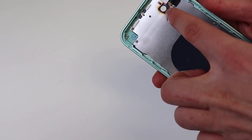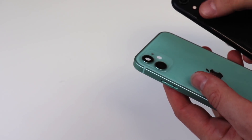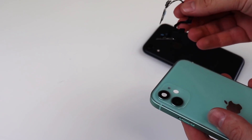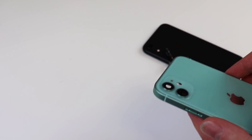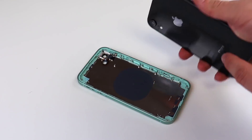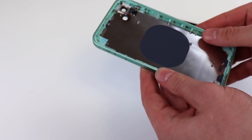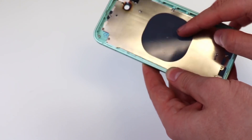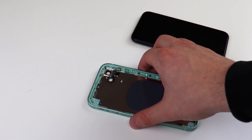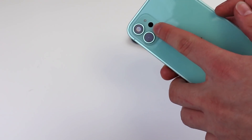You can see that the flash is over here, where in the iPhone XR the flash is over here. We were provided with a module to actually move the flash over. Hopefully that works as promised. Essentially we have to transfer all the components from our iPhone XR over to our iPhone 12 housing. This housing is completely naked, not even including the charging coil or the volume or vibrator buttons. There is a fake camera located under the real camera, and the flash will also be moved to the left.